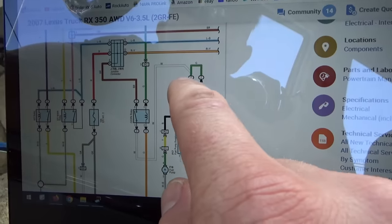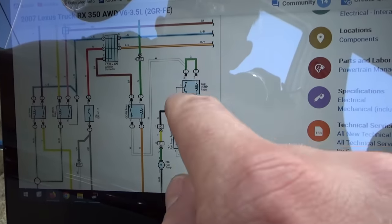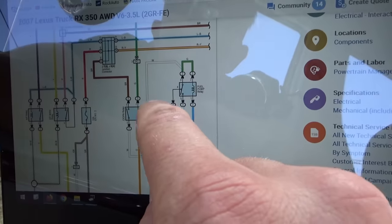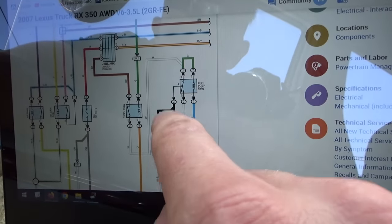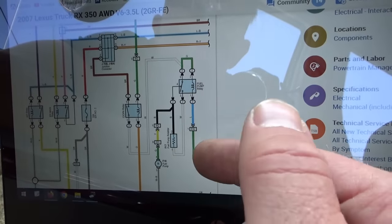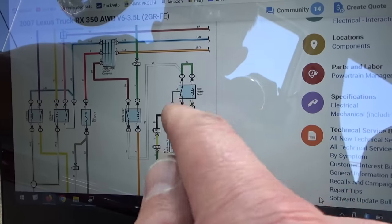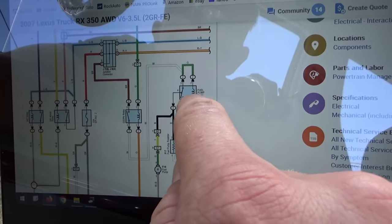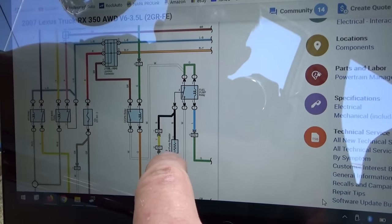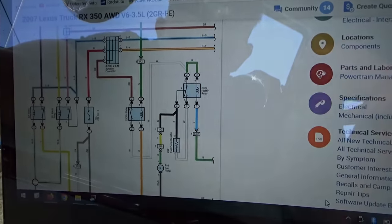So whenever this relay clicks to low speed, that's drawing a lot of amps. And then when it clicks to high speed, the fuel pump's supposed to be energized full speed, but the current's actually backfeeding through the fuel pump resistor to that shorted, you know, short to ground. Pretty insane. Okay? So that pin right there at the fuel pump relay, now we know which one that is. That one's not supposed to be shorted to ground. The white wire at the resistor is not supposed to be shorted to ground. We have to find that short to ground. So we're actually getting very close.